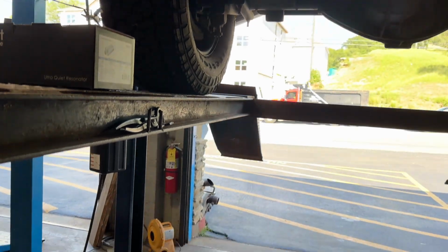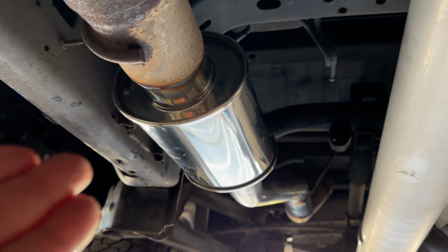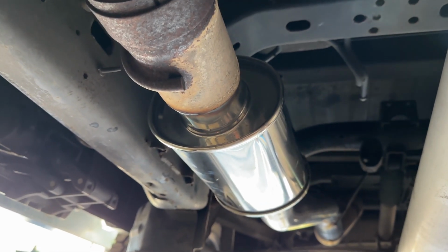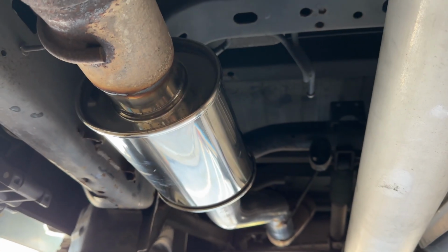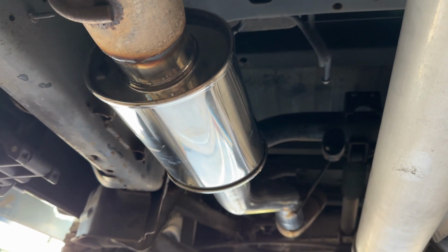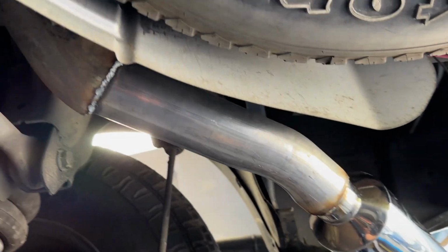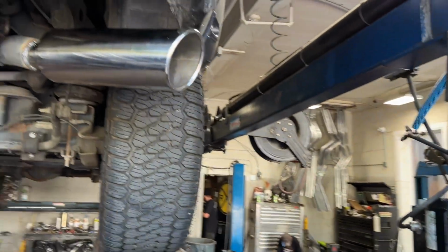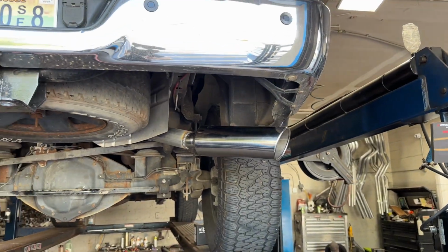because the muffler itself is very, very restrictive. So even though we changed it, this is a straight through flow Vibrant, so it opened it up drastically compared to the restriction from the stock muffler. So anybody who says, oh, you put 3-inch, what are you doing choking it down? No, we didn't choke it down. Anyways, 3.5-inch tailpipe, and then we took the resonator off that was choking it down also, and put a pipe in its place, and installed a 5-inch rolled by 18 stainless steel tip.